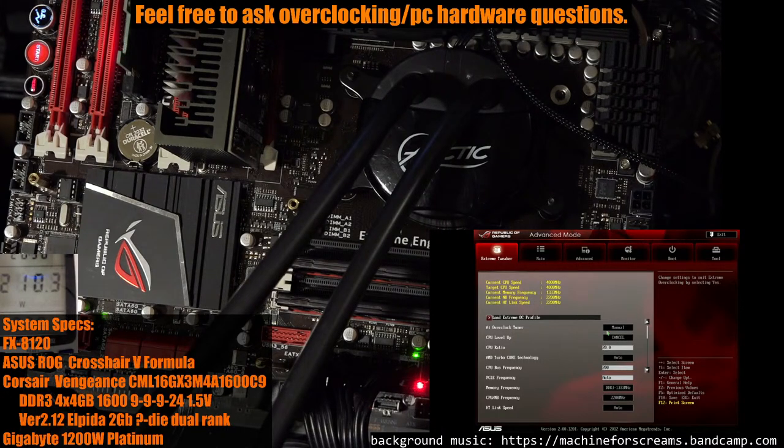If you only have offset Vcore, it might max out kind of low on the core voltage, but if you're on dry ice, that's not a concern. That was the issue with the Gigabyte board: it was offset voltage, and I was like, oh, it offsets to like plus 600, and I can set the VID to 1.55, so logically it should go over 2 volts, and no, it doesn't. Turns out plus 600 offset does not add 600 to arbitrary VIDs. Can pump over 2 volts. You won't need that on dry ice, though. In fact, I think on dry ice that might break the CPU.